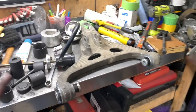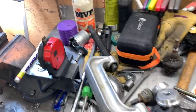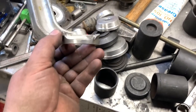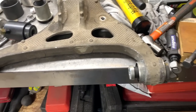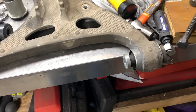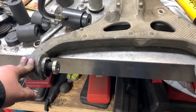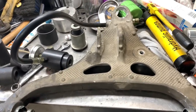I'm gonna give you a word of advice right now: this is not worth the time or effort, trust me. I thought it was gonna be a lot smoother. I messed up one bushing — money down the drain. Spent so much time machining stuff trying to make something work. My little tool worked alright, but then towards the end it took a dump. You gotta figure out how much time you're spending trying to save a few dollars. There's probably a reason why on the internet, if you Google 'lower control arm F-150 bushings,' everybody just says just buy a new control arm. Don't waste your time. I'm going to put the ball joint in this one and just get a new control arm for the other side, because this is brutal.